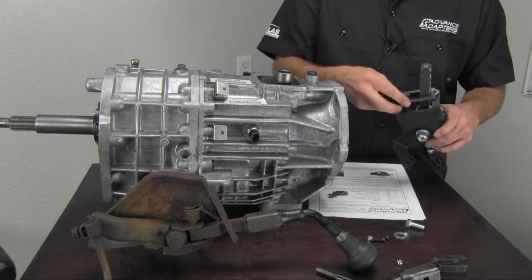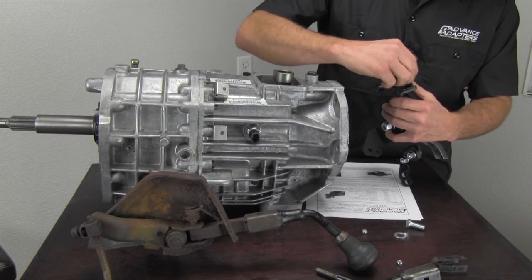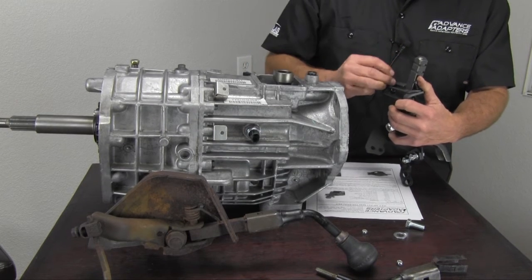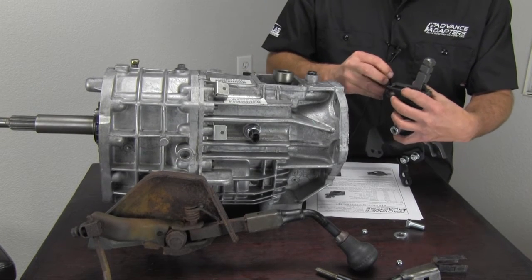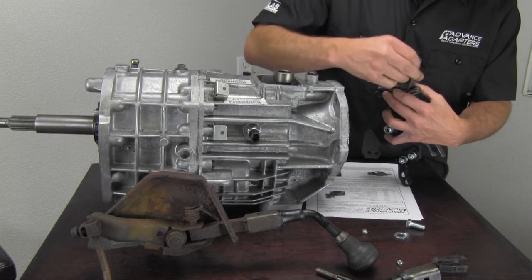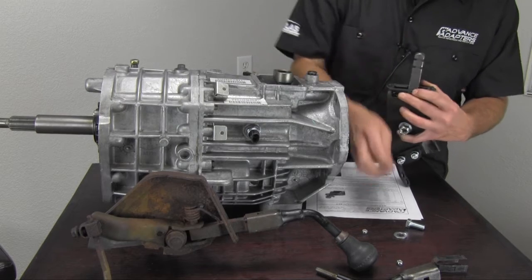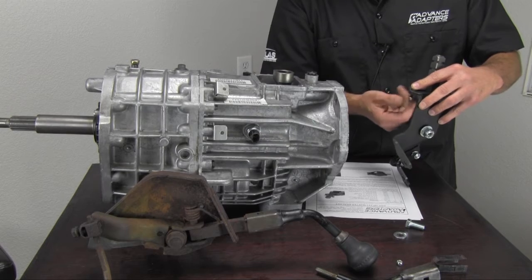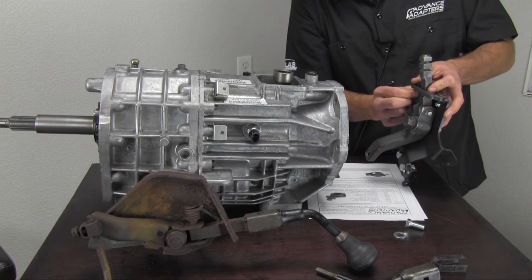From there, you have your gate — put that on there. You have your two new small bolts that you basically put down through the bracket. They have a little slot in there, and the handle is fighting a bit with the spring-loaded tension. Go ahead and nut those on the back side. These are all nylon lock nuts, so once they go on, they should stay on there forever.